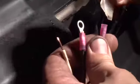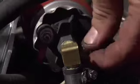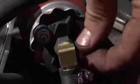With the new fuel pump harness routed to the pump, use the included ring terminals to connect the harness to the pump. Again, take note of the wire color to correctly connect the fuel pump to the valves. This completes the standard equipment installation for your Ford Powerstroke Greasecar conversion kit.